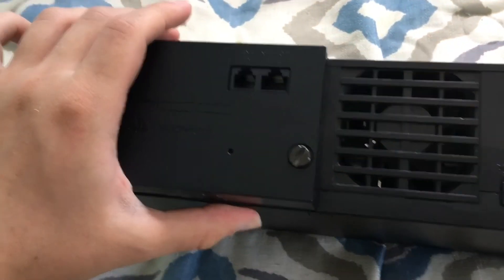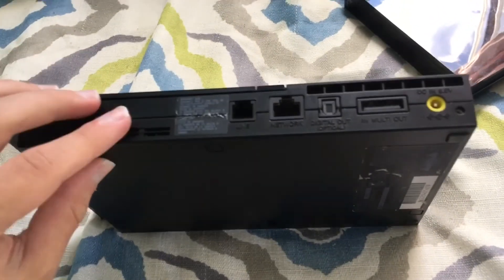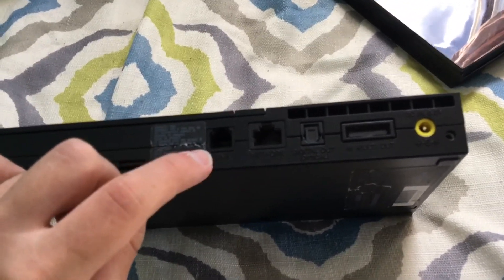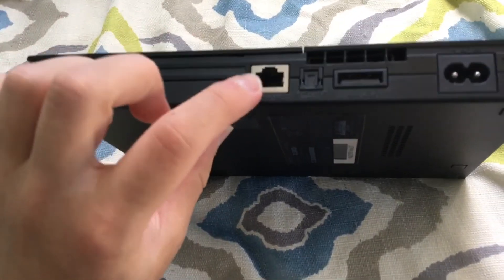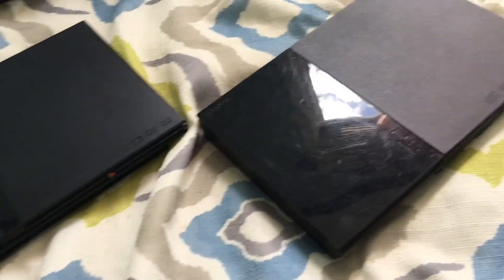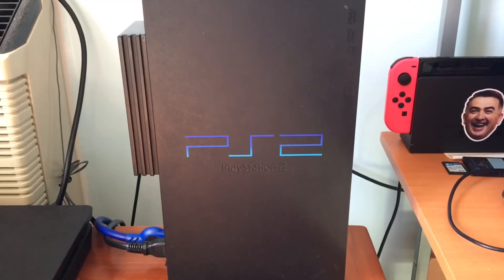Other options include the PlayStation 2 slim — luckily this has the ethernet line built into the system, and some earlier models even have the phone line. However, 70,000 models remove the phone line, and the 90,000 slim doesn't have it at all, but it still has the ethernet port, which is what we need. At this point, everything we do applies to all three versions — the only difference is that the original model requires the network adapter.